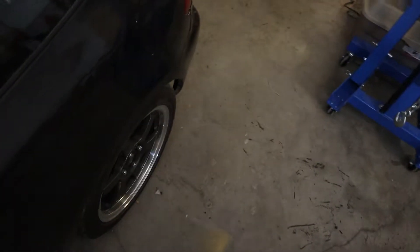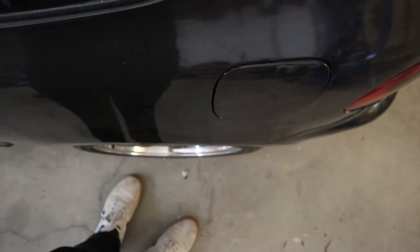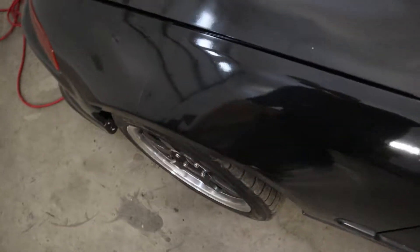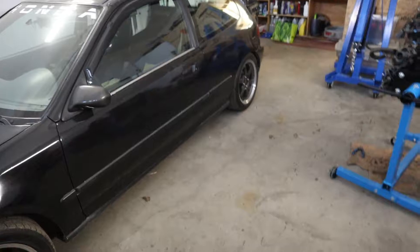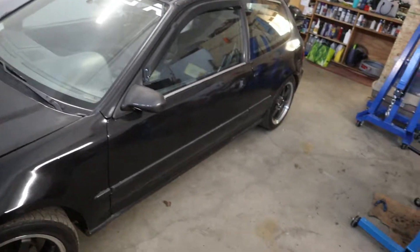As you can see here, we're not flush — we're sunk, and a good bit. In the front, even though the wheels turn, it's still just a little bit sunk. So 15x8 will 100% fill that up. The 16s don't look bad on this car, but the 15x8 will look a lot better than 16x7s or 15x7s.